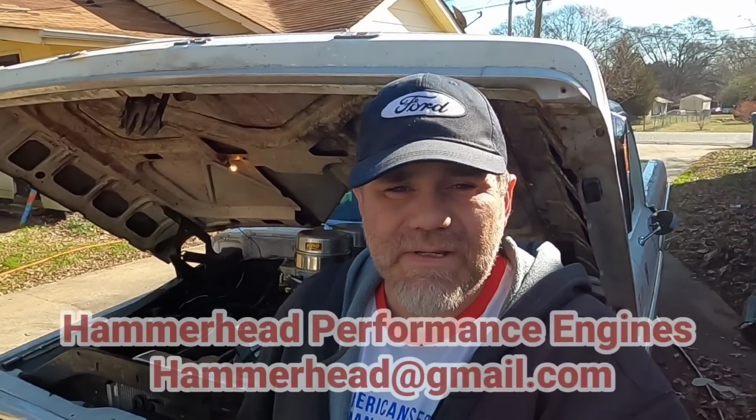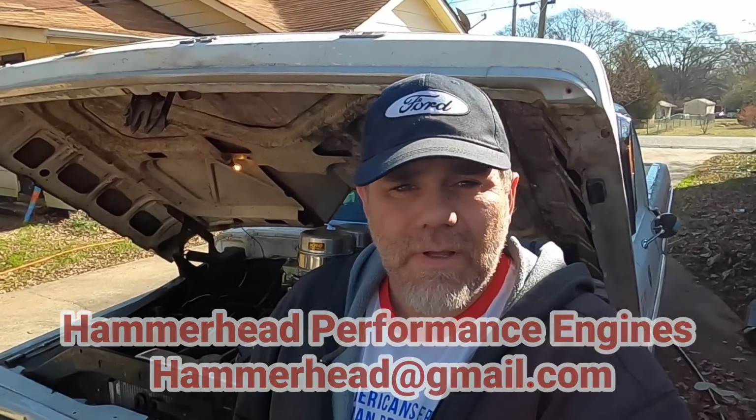So to give you a rundown of what this engine is, because there's a lot of new viewers to the channel, this is an engine I've dubbed Project Mixed Up Boss. It is a Frankenstein of engines, basically. Has Boss 429 style heads by Greg Brown of Hammerhead Performance Engines. They are just phenomenal. I have a whole playlist on this engine. I'll put it up here in the corner somewhere so you can go check it out. But this engine made 708 horsepower and right at 600 foot-pounds of torque, naturally aspirated on 93 octane pump gas.